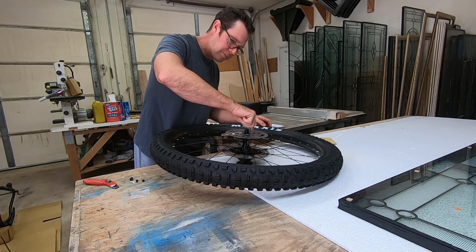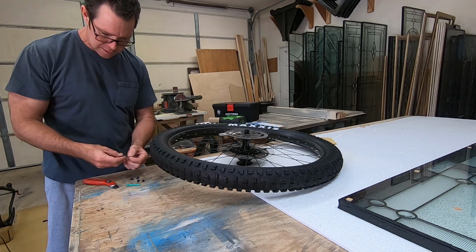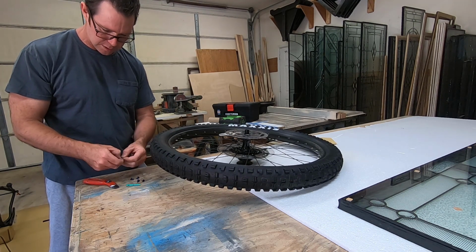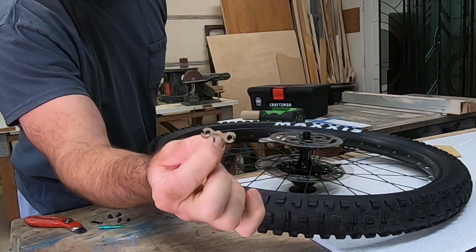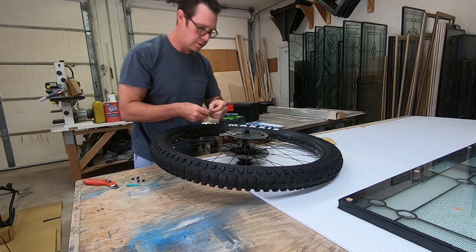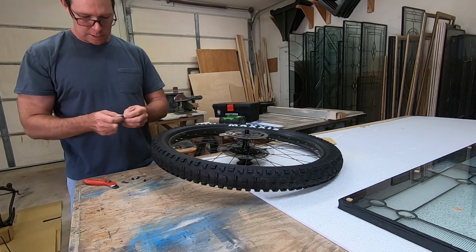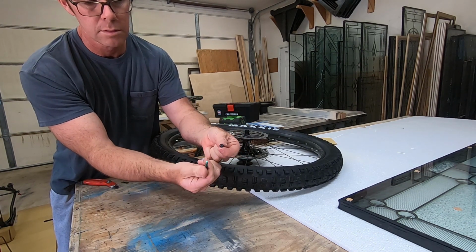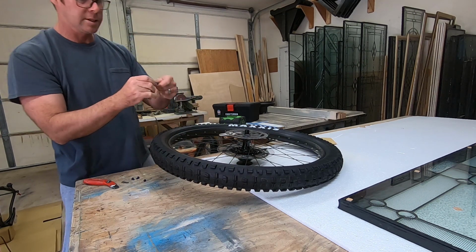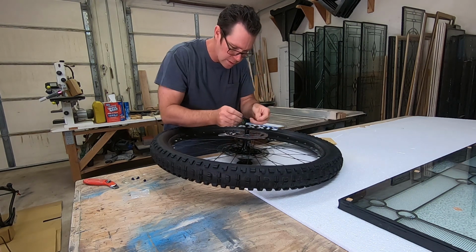So they give you these little metal clips that connect. They're kind of like lock washers, and they connect the screw heads. I'm not exactly sure how they work, but they're supposed to help with them not coming undone. And they look like this. It has a little decal on it that says top, so you want top, obviously, on top. The rotors are screwed on with a T25 star bit. So you think you got all the Allen wrenches, and then they throw a T25 star bit at you, or sometimes even T15, depending on different things.